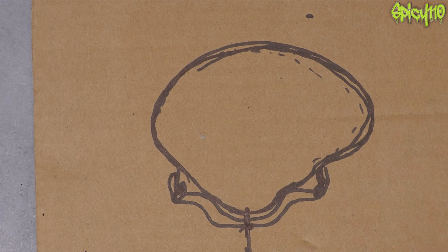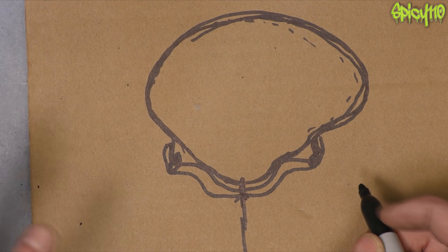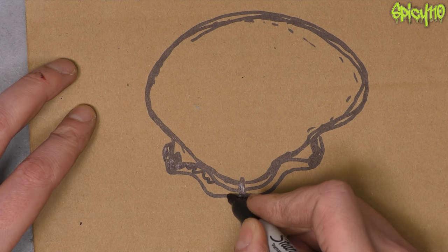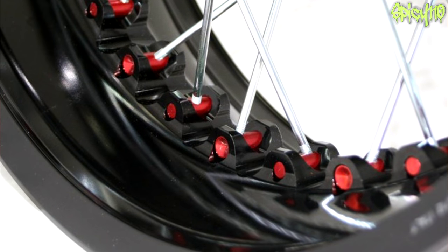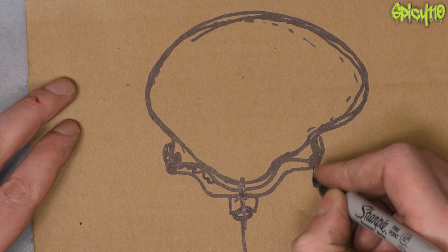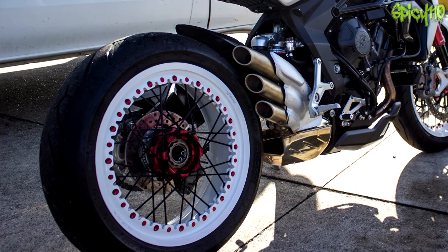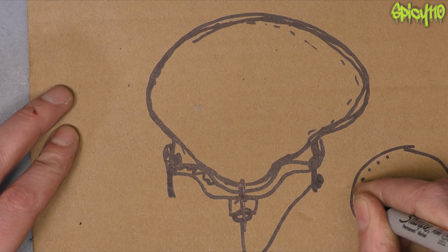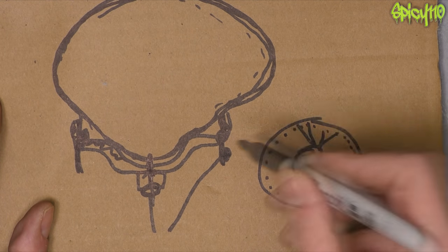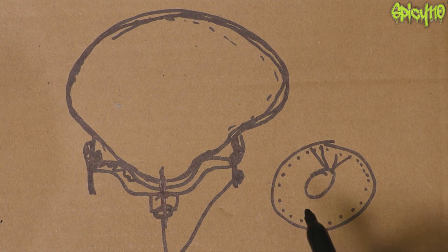Now I'm going to tell you about the third type: the tubeless spoked rim. There are a couple of ways of doing this. Either you have the same profile as a cast wheel with no holes, and then you have a track welded on the inside that doesn't break through, and you attach the spokes externally and do adjustments elsewhere. Another way is they put a flange on the rim and the spokes come through that - like MV Agusta perhaps - where you end up with lots of little colored things around the wheel with spokes attaching to them, never coming through to the inside, so you don't lose air.